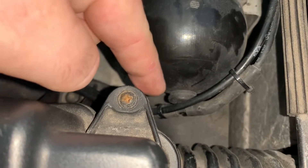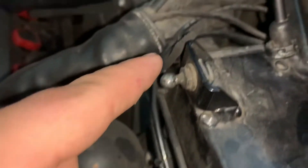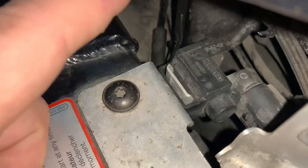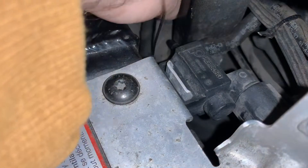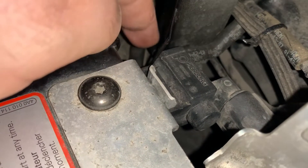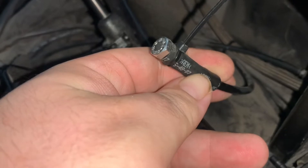It is not this one that you need to blank off — you need to follow the right-hand one. It comes around the engine bay into the wing and then you get to this Pierburg solenoid, which is the electronic element of the vacuum control. That vacuum pipe will connect on there, so you just pop that off.